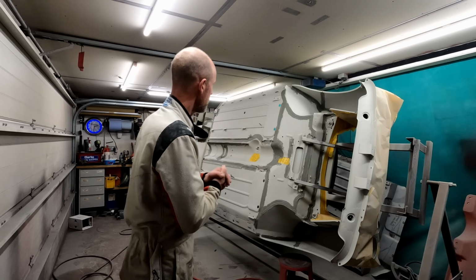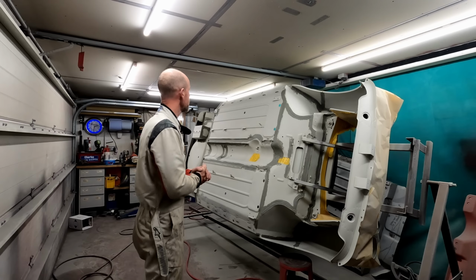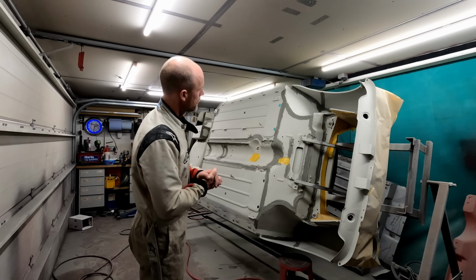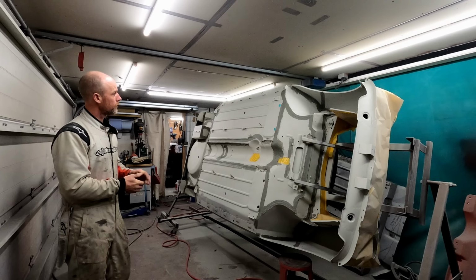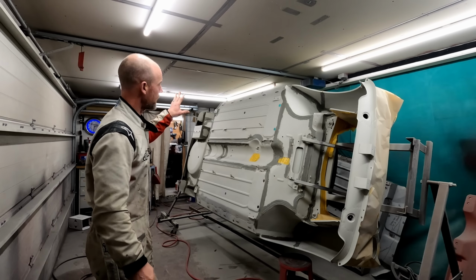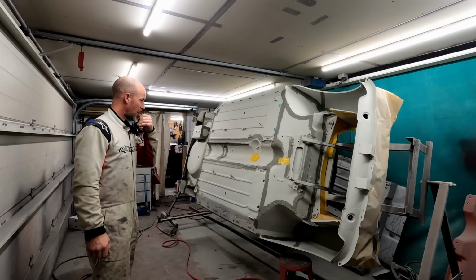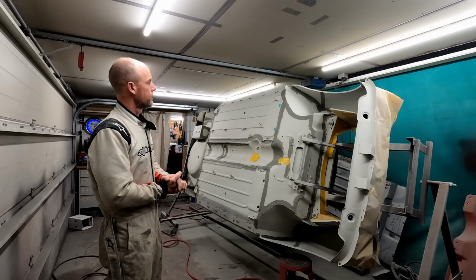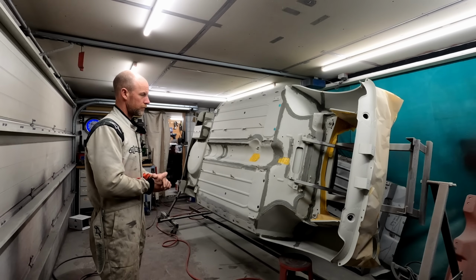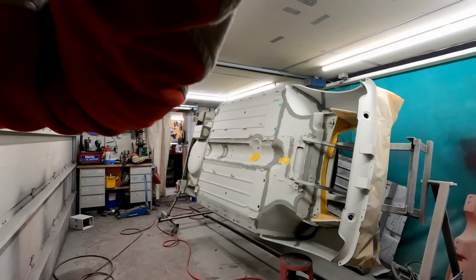Welcome back. So yeah, it's the next day. I've put on the seam sealer in the areas that I want it put on. I've scotch padded all the primer, and so I'm ready to apply the Raptor. Colour looks good, so I'll just show you what I've done.